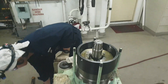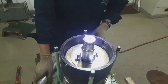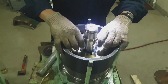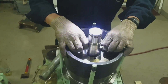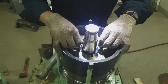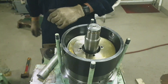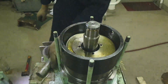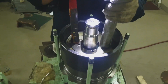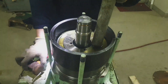Put some oil around the sealing ring so that it will slide smoothly into the inserting tool of the piston. Use some soft material - zinc anodes or brass - and just push it slowly all the way down into the air cylinder, adding lubricating oil to make it go smoothly.